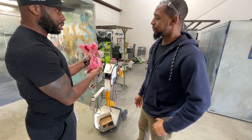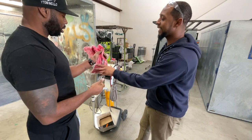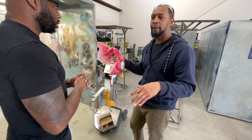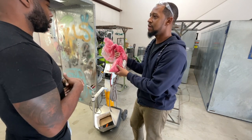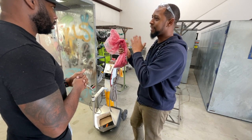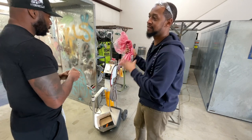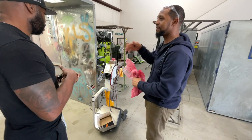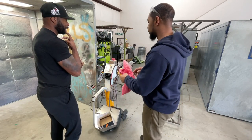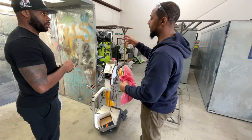How much powder does it take to coat a set of rims? For a 22-inch set you should be able to do it with about two pounds. That's how they regulate it. I had barely enough — maybe half a bag — but I was able to spray those wheels. Having a good gun and the right technique matters. With a two-color layer process, you spray the red first, put it in the oven to gel out, then pull it back out before it fully cures.